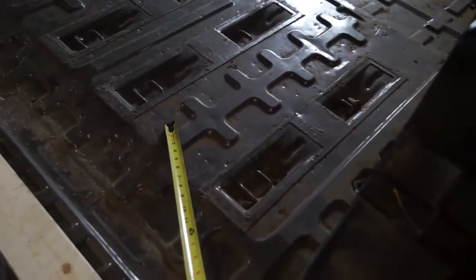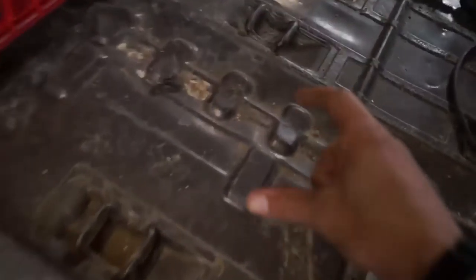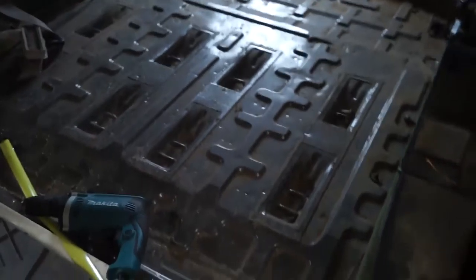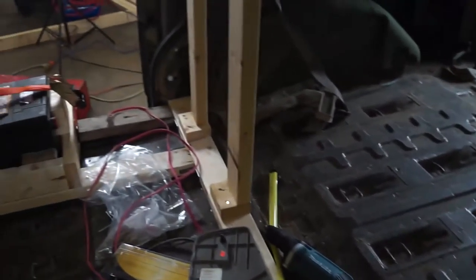As you can see, sometimes the floors actually get crushed, and if you look here, you can see that these ones have been pushed down. The reason for that is we at one point were loading auto scrubbers for cleaning into the van, and the wheels with their narrow point of pressure ended up crushing these, which slightly weakens the overall structure of the van, which sucks, but it shouldn't be enough to be serious. So to prevent that in the future, the idea here with these load-bearing foundation planks is to prevent that kind of crushing and to even my load everywhere. So at no point anywhere on the metal do I want a single piece of wood coming down and sitting on top of it, because it will punch through it.